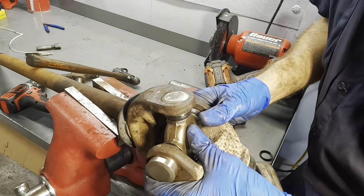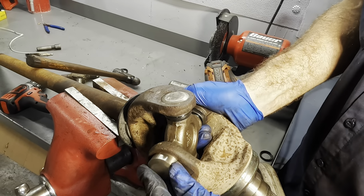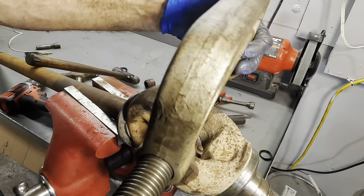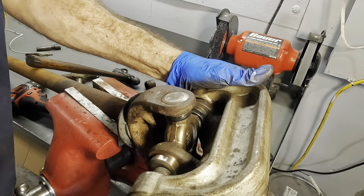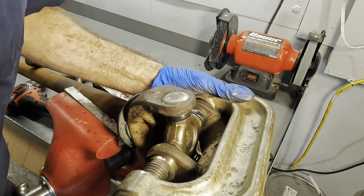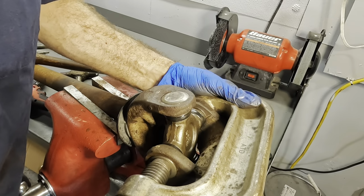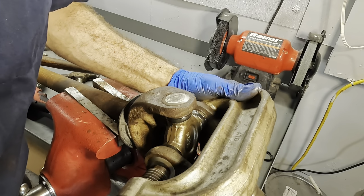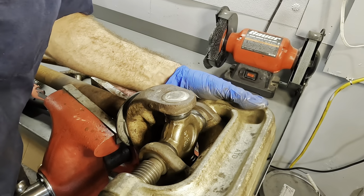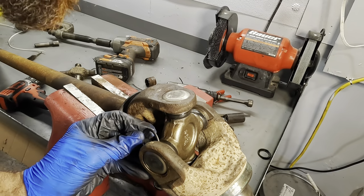Get down there. Let's slide this thing over. Okay, all the needle bearings feel engaged. That's good right there. Come back around this side and we'll press this other cup in position. Feels good. It's in. Now, let's get our final clip clipped in to its groove.